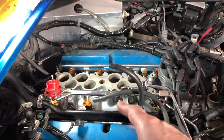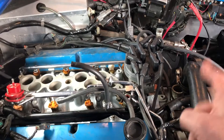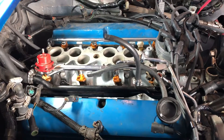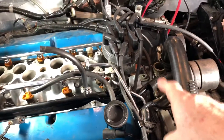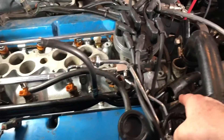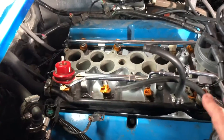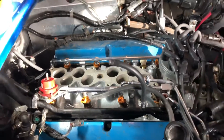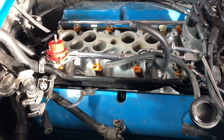When you buy a gasket kit for the intake manifold, the upper and lower intake manifold kit does not come with the thermostat housing gasket — I thought it did and I was incorrect. Remember you're going to need to replace that gasket as well. There's a hose on there that's nearly impossible to get off, so I just took the housing off itself. Once you've removed all of that, there are just 12 bolts — six on each side. Take out those bolts and it comes right out.